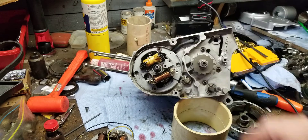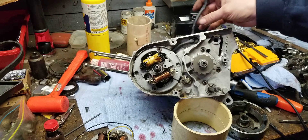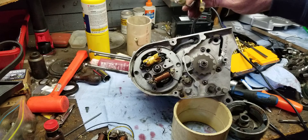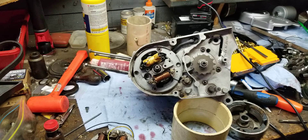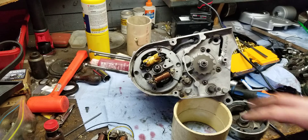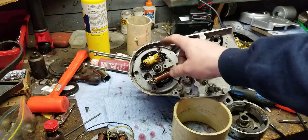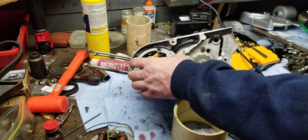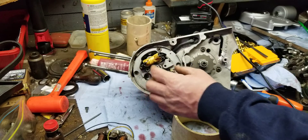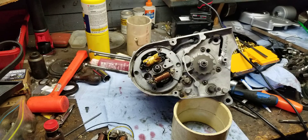I had to replace the ignition coil, but I used the same factory wiring — I cut all the old wiring off and put new heat shrink on with the factory connectors kept. When I put it all together, I checked to make sure I had all the air gaps and nothing was touching. One side was touching, so I had to grind and file it down to make sure I had a nice air gap and that nothing is rubbing electrically on the center part.